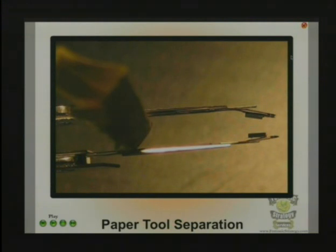You can also see from the way this piece of metal moves that the whole idea of the hard drive was made so that when the pressure from the air was spinning up and the platters were spinning up, that pressure is what's pushing up on the head. You can see how flexible these things are. They're actually made as a triangle on purpose because it gives the most rigidity at the end, takes off all the extra metal, and they cut holes in it. The same goes for the holes on the arm, where the airflow actually helps — kind of like the wing of an airplane — push those apart in a certain pattern so the head can float.